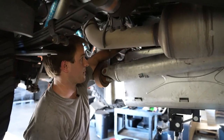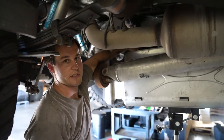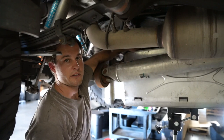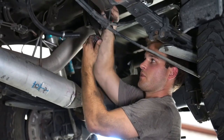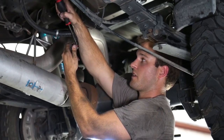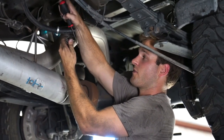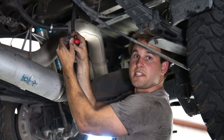After removing the hose clamp and removing the vent line, now we're going to go to the electrical connector, and we'll show you this after, but you're going to slide the red tab completely out, and then you're going to depress the button. To get that electrical connector off, what we did is it was plugged in this way. We used our flathead screwdriver to push the red tab all the way out so it falls off. Then the button to depress is on the top.